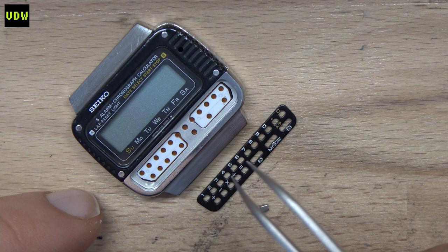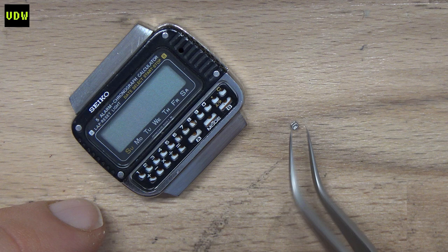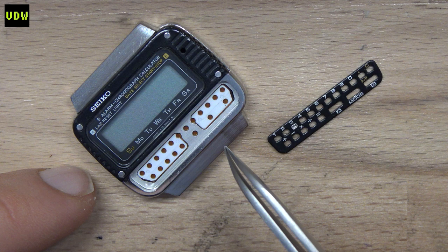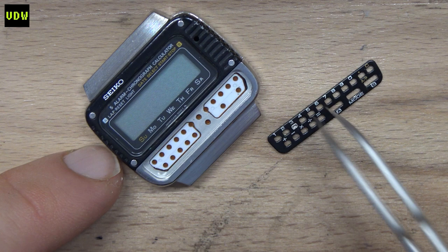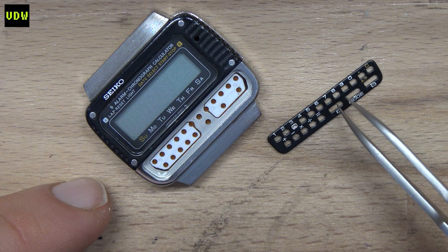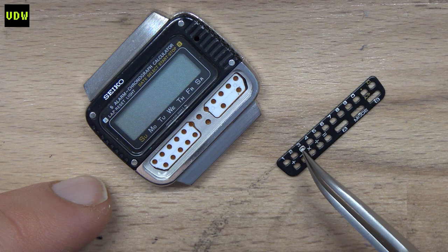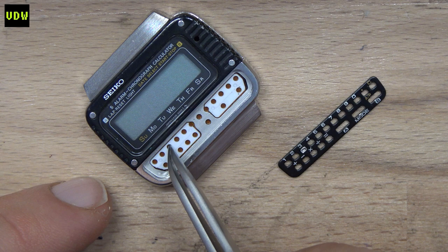Here it is on the bench. This is how the watch looks with its front button plate removed — it would sit right there. This is one of the tiny buttons fitted from underneath. The part that is always the failure and always the reason the front buttons aren't working is not there — that part is actually a rubber frame that holds the keyboard front plate into place, and it has a special shape.